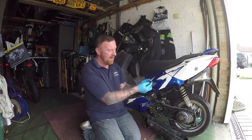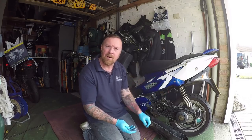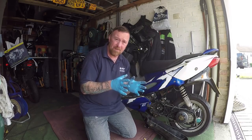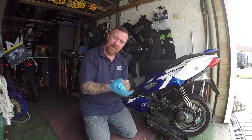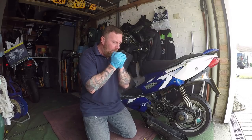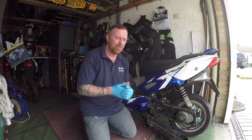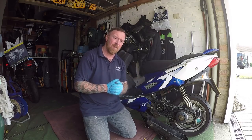Needle I always talk about, these get bent, and this is bent over slightly here. Anyway, I digress. The carburetor was a bit odd shaped, but it still came off, turned upside down, found the jets, sprayed them all through like I do in the cleaning videos, so watch them. I've got a couple of videos, one Lexmoto, one a little Scout, I think it is. They're on the end of this video. Watch them, they're helpful advice for you.